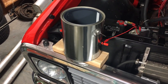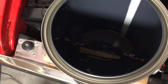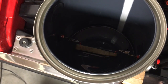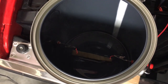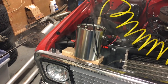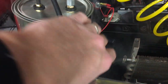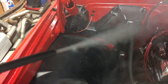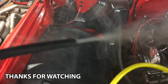As it turns out, my six-volt lantern battery was dead, so I brought it out to the garage to see how it does out there. Works pretty good. Let's put the lid on and try it that way. Here's the final product working. I've got my regulator down as low as it will go on my compressor, and it's producing quite a bit of smoke. So what you do is plug this into your vacuum port and just look for the smoke — see what's coming out of your motor. And there's your leak. Hope you all enjoyed.